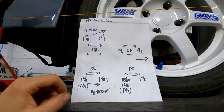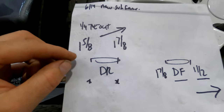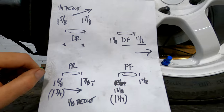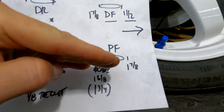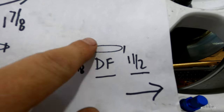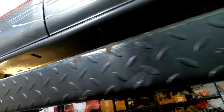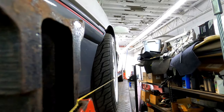Here are my measurements from the ground. I pretty much guessed on the thread count with the rear end links and came out pretty close. Driver's side rear is only a quarter inch toe out — not bad. Passenger side is only an eighth inch toe out. I'm going to try to send it to zero. Passenger front is about a quarter inch toe out. Driver's front is quite a bit off — I measured three inches to the hub, one and a half inches on the front side of the wheel, and one and seven-eighths to the rear. So the front is actually pointed outward compared to the rear — I can actually see it.